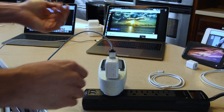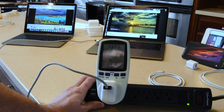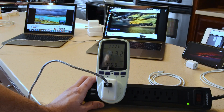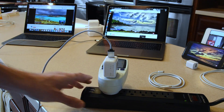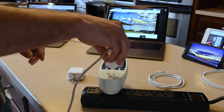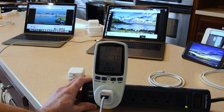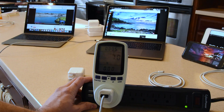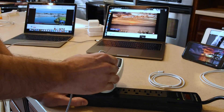At 13 watts, we're probably going to consume more electricity than we're putting into the battery. But in an emergency, you could shut the screen off or go into battery conservation mode and still charge. It would take roughly four times longer than the built-in charger at 13 watts, but it's a very handy thing to have. Since 5 volts is clearly working, we should get about 5–7 watts from the iPhone charger — very slow, borderline useless for extended use, but we're getting a full 7 watts, a little more than the stated spec.